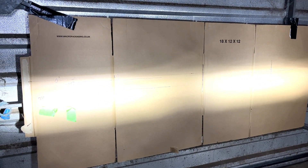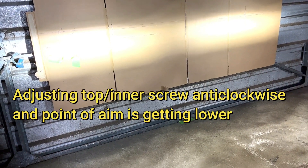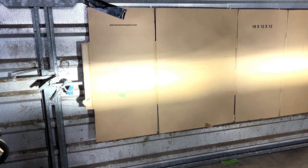It's difficult to see exactly where the centre of the beams are, but it's reasonably easy to see through the camera. Let's see if I can find the headlight and figure out which direction to turn them. It's going down — turn them anti-clockwise on the top screw. Bring the cut-off just down to it. It's quite difficult to see the exact positions; it's washed out the light quite a lot on the camera.